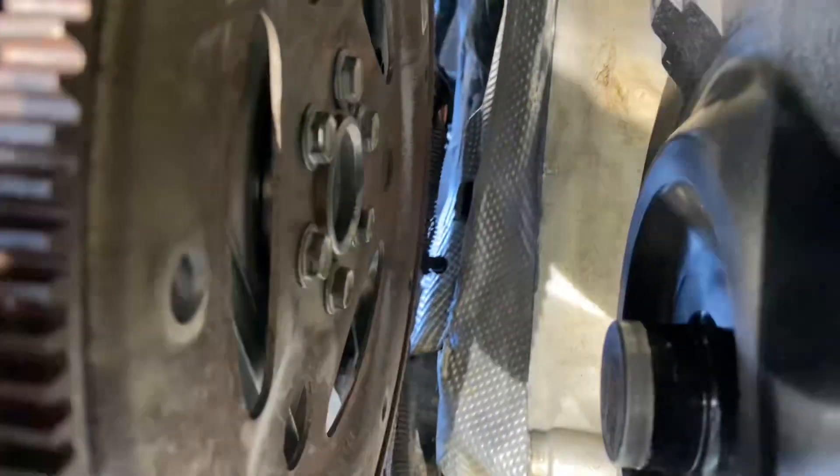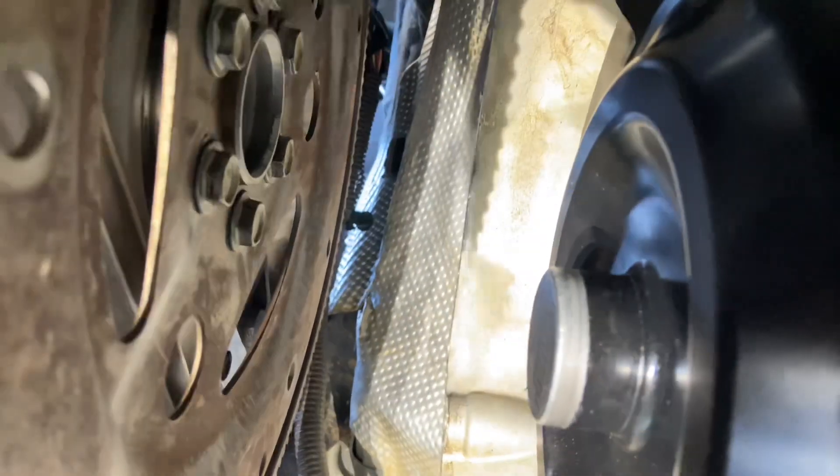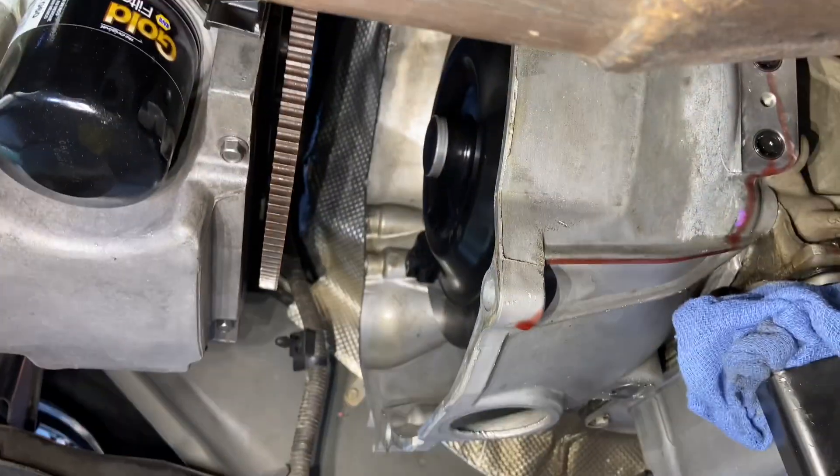I let it set, we went to drive it uptown, and at the stop light it sounded like the motor was about to come apart. It ended up being the flex plate was just loose — the bolts were starting to back out. They were sitting flush but starting to back out some. So I slid the trans back and re-torqued all the bolts on the flex plate and put some Loctite on them.